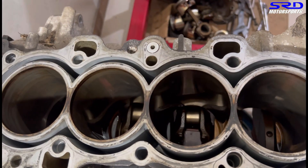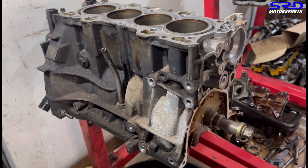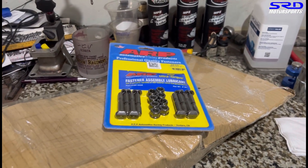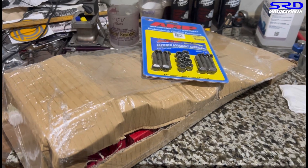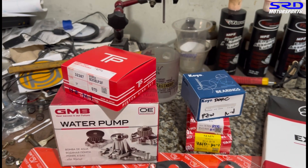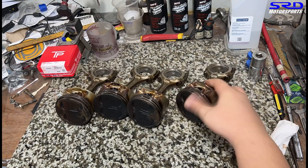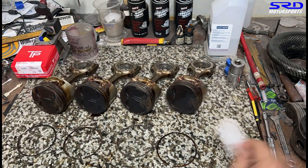Here's the block — the crank is still there. We checked and everything seems okay, so we're going to give it a further look with you guys. All the parts came in: I ordered the bearings and piston rings from HRC. ARP rod bolts came from Downshift Supply in Marikina — Carlo is a good guy, they own the shop. Let's unpack the package. Here's the water pump, Gates OEM replacement belt, tensioner, rod bearings, main bearings, and the piston rings. Now let's check the pistons. We haven't really cleaned them up. You can see the dome has more carbon on it. Someone said it looks cooked, but we checked the specifications of the crown and the skirt — there were no signs of overexpansion, so it didn't really run hot.